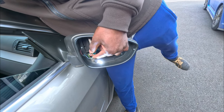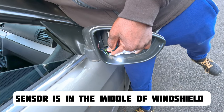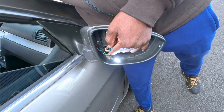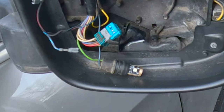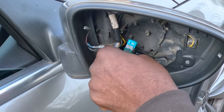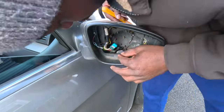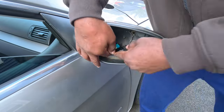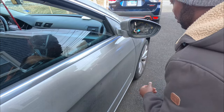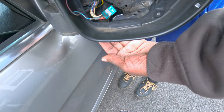There you go — you can see the light comes on. The reason it wasn't coming on is because you have to block the sensor. Since I'm doing this during the daytime, the sensor stops it from coming on, so it only comes on at night time. See, it went away. Now all we have to do is put this bulb back into the housing — you may have to play around with it because it's a rubber fit. Got it — you have to put it in at an angle. You can see it's still working, so we installed it properly.